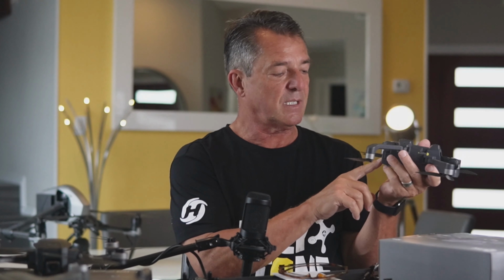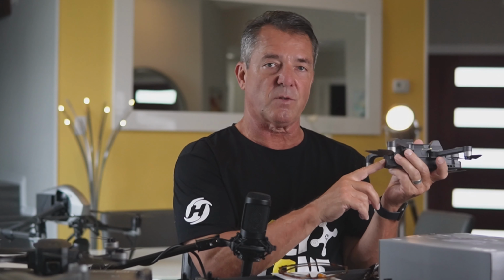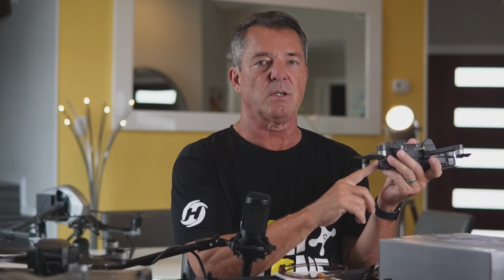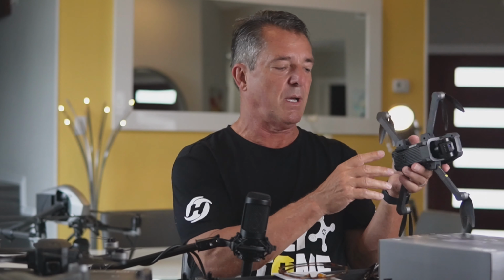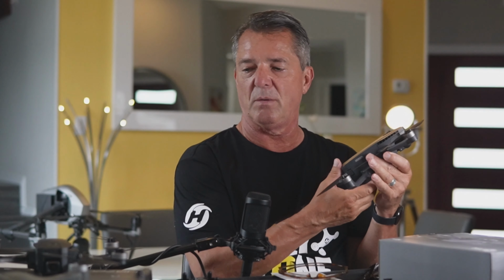In part one, if you missed it, I go over the app and everything, how to get the Wi-Fi done, how to get it calibrated, how to get the remote connected to the drone, the compass calibrated, and all the aspects of the app. But today we went over the flight characteristics. One thing I didn't like about this drone, and I mentioned it, was it took forever to go down to 2 bars, and as soon as it went down to 1 bar, it landed. So if you've been flying this thing for 20 minutes, it's time to bring it back, because it doesn't give you a battery percentage. It's hard to go by the lights in the back. If it ever gets to 2 bars, it's time to bring it back. Don't wait till it gets down to 1 bar.